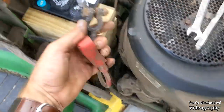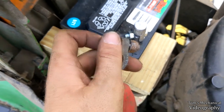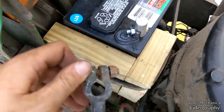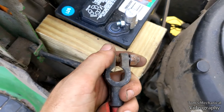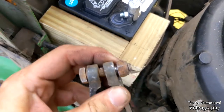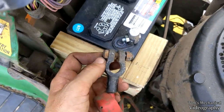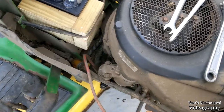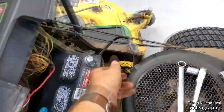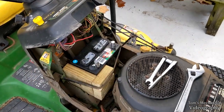Also noticed that terminal bolts were on backwards. So, you see this? You see how there's that little shelf there? Well, the square head's supposed to be on that side, so that it doesn't, you know, rotate. And also these lock nuts, pro tip, you put them on backwards, and that acts as a little standoff where the nylock is, and that'll let you get a wrench on it a lot better. So I'm gonna flip that one around. I already flipped this one around, see what I mean? And pull that out, boil it, do a dump run, and be back in a jiffy.